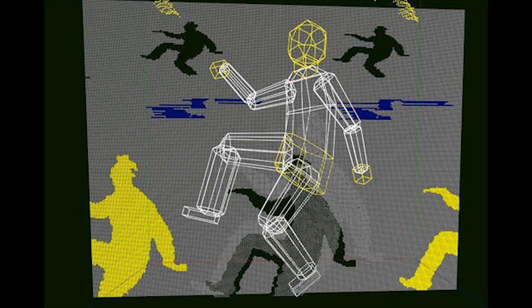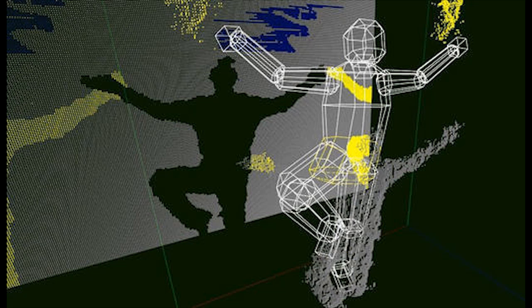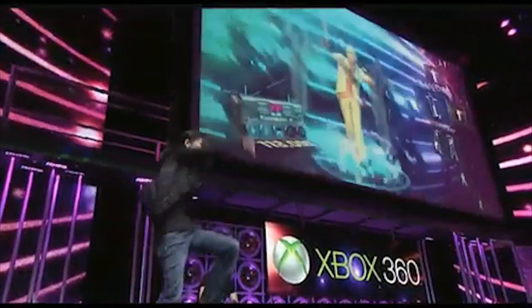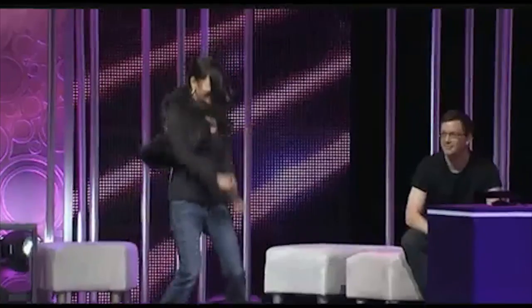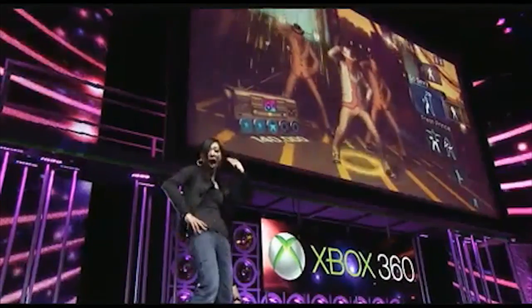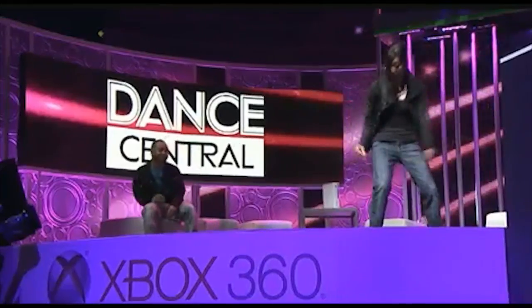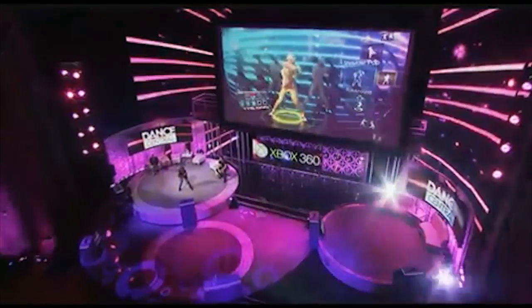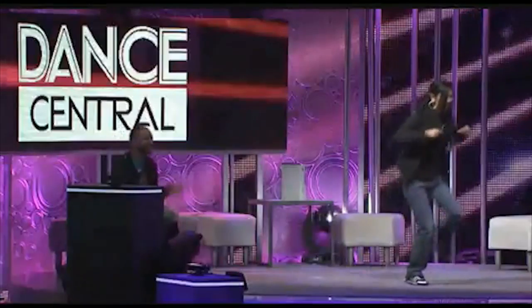This is all done within a few thousandths of a second, meaning that it does this for every image and easily keeps up with the refresh rate of the IR camera, 30 frames per second. It's this motion of the 3D avatar that's analyzed to determine the gestures you use to control the game. Kinect also has a few nifty features to complete your new controller-free existence. For example, it can use your most recent frames of previous movement to take an educated guess as to your current state, even if, say, your arm is obstructed by your body for a short period of time.